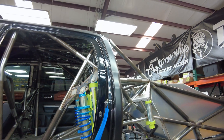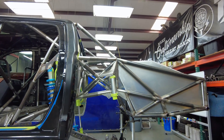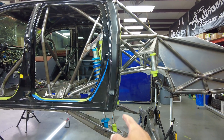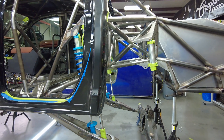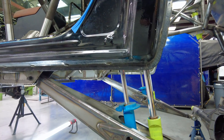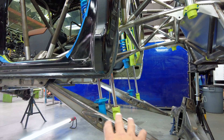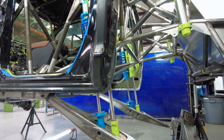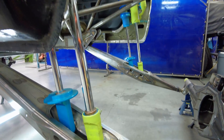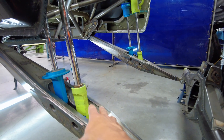Right off the bat you can see that there's shocks in the cab. We talked about shortening the wheelbase — so you know what that entails. We're running a 55-inch trailing arm. There are a couple different versions of this trailing arm and this is a Blitzkrieg trailing arm — Nate does these and I have a good relationship with him and I like his products. This is more of a standard traditional trailing arm — it's a canoe trailing arm. It's pocketed, and canoe is just a visual thing — you can see it's kind of shaped like that with an opening for the shocks in there.